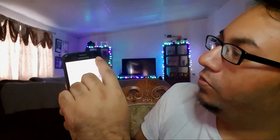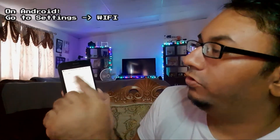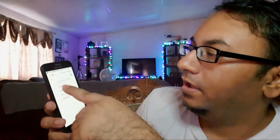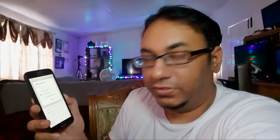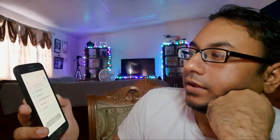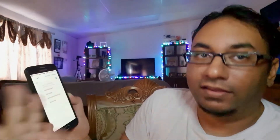So we leave the drone for a second and I'm going to connect it up on the phone. I'm using Android 7 on a Samsung S6. I'm going to the Wi-Fi settings and clicking on Wi-Fi to scan. I'm scanning to see if I see it — and I do actually see the Mavic Air come up as a protected, secure network. So I'll click on that and put in the password. I'm pressing the connect button and connecting right now. It says internet is not available, obviously, because we're connecting to the Mavic Air which doesn't have internet. It has successfully connected, which is really cool.